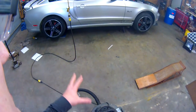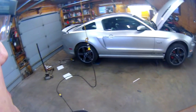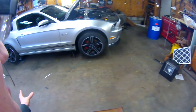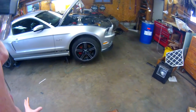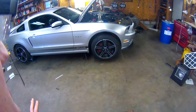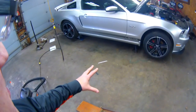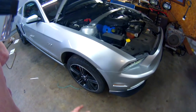The first thing I did when I bought the car was drain the manual transmission fluid and put Royal Purple Synchromax manual transmission fluid in there, because some people seem to have problems with these MT82 transmissions — sometimes they're great, sometimes they're terrible right out of the box. Mine was good, no synchro problems, no grinding into gears. I drained the fluid right when I got it at 30-something thousand miles. So I have Royal Purple in both the transmission and the differential.